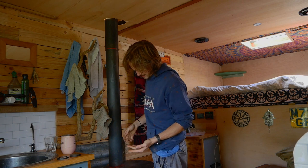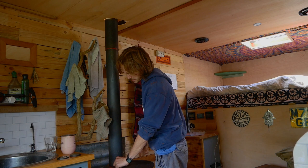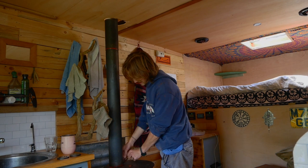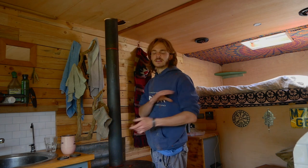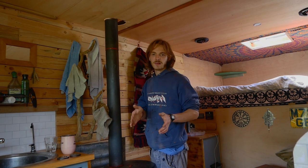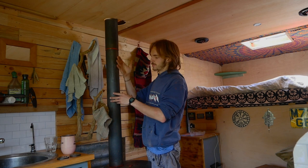I have had this off before when I was sealing it up - that's why I want to redo it, because I did it the wrong way around. I had to put RTV sealant on. It's backwards. You want the top layer to sit inside the bottom layer so all the condensate that's inside dribbles down when it gets hot and then goes back inside the burner.